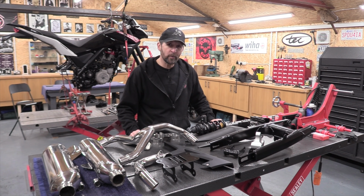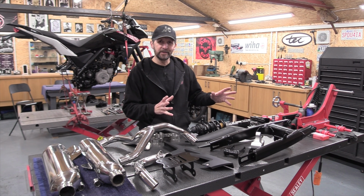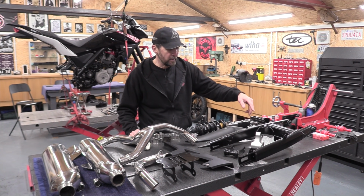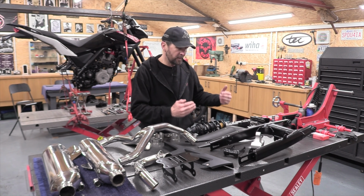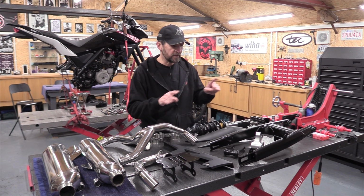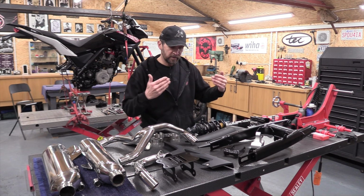Okay, finally got all the parts ready. Everything's restored and cleaned and shined and polished and painted. Now ready to reassemble. So today it will be swing arm, short link assembly, temporarily put the factory shock back in until I can get a better one, then put the wheel in, put the chain on, rivet the chain and put the chain guard on.